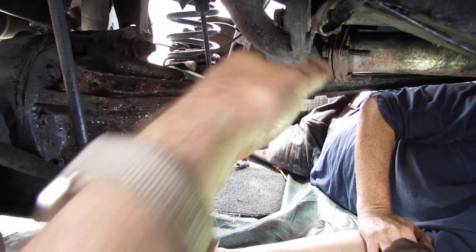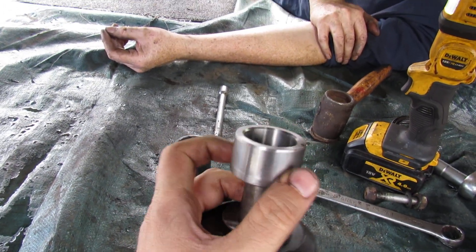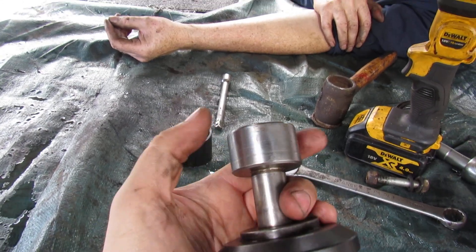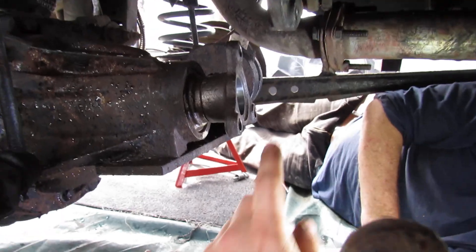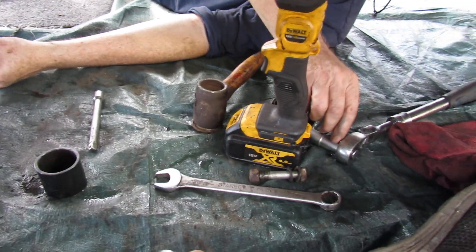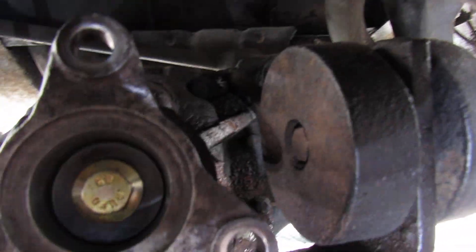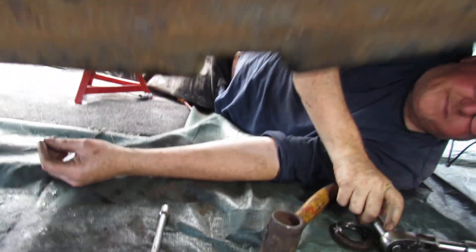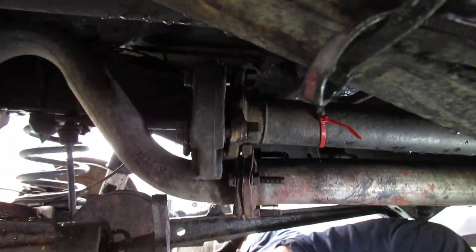What we need to do is remove the flange and then we can remove the seal. But first we need to remove the centering pinion that the prop shaft sits on. It's got an 8mm bolt that goes in the middle. There's also a 16mm nut — I've got one here to show you for reference if you haven't done this job before. The prop shaft bolts are 19mm.